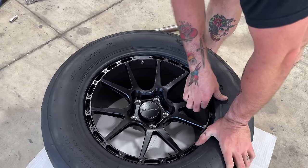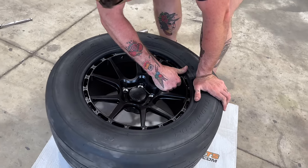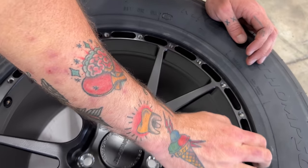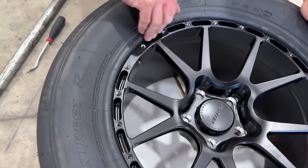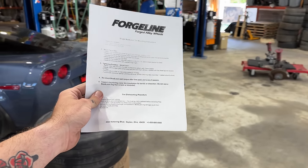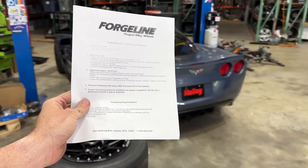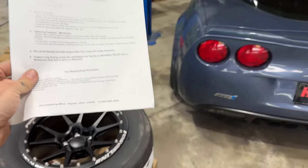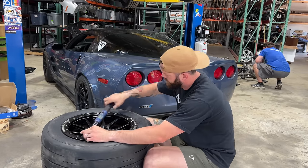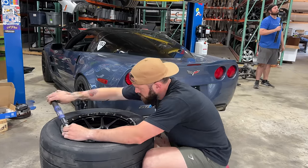Now we just have to get it situated around the inner part of the barrel. As far as I'm aware, that's pretty well how it should be. This may be the first time — and it may be the only time — you see this on the channel, but we're actually going to read the instructions here. These need to be torqued to 18 pounds after a certain sequence. We're not going to skimp out, not going to ugga-dugga it. We're going to do it the right way for once.